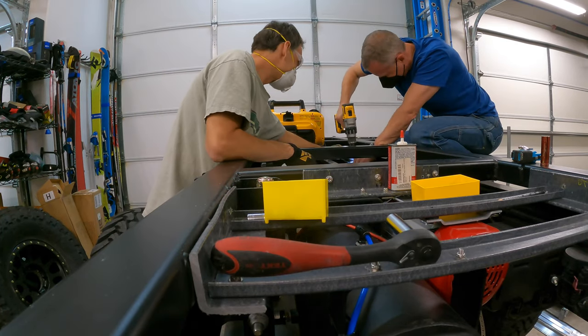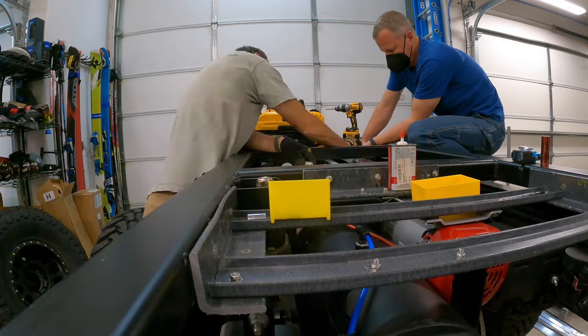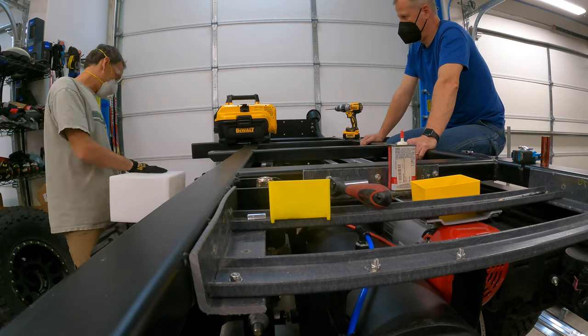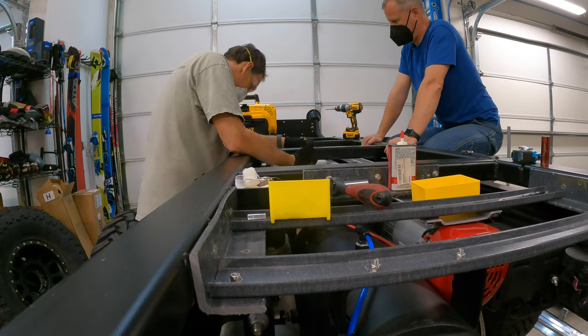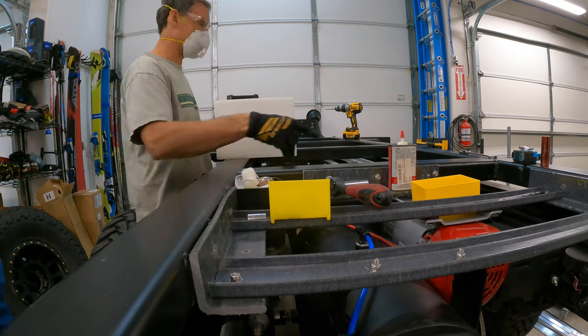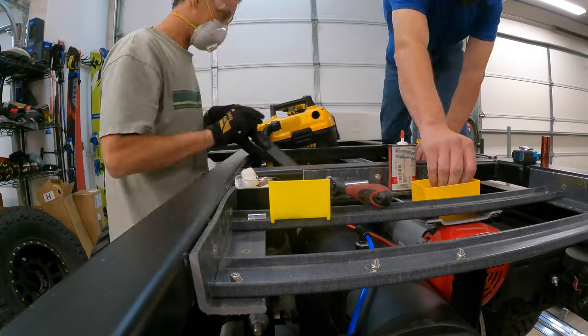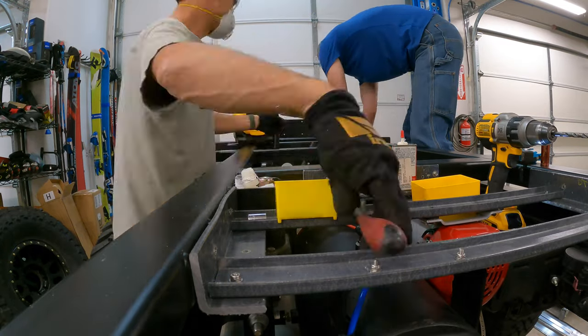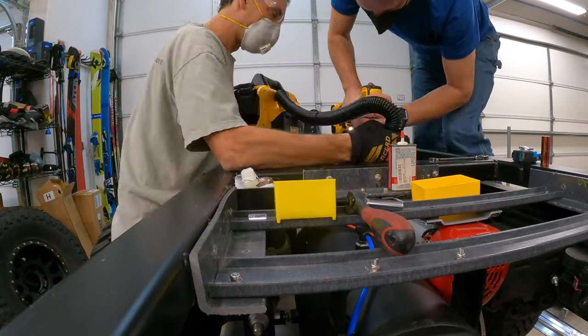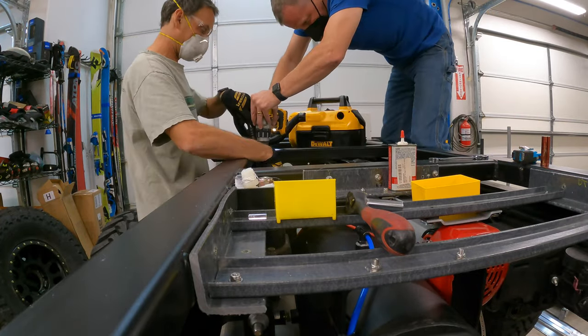You can see more of the fiberglass U channels that hold up the Extreme Outback air compressor, the air tank, and the fittings at the top. One thing to note is that the airline run throughout the chassis has no low spots — it runs at the same level or dips down only at the outlets at each corner. There's no point where water can pool before it reaches the outlet, so it can always drain out at the outlets or at the drains in the tank itself. That's why the air outlet for the tank is at the top, to prevent water from accumulating in the airlines.